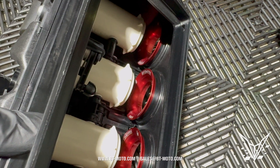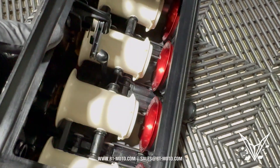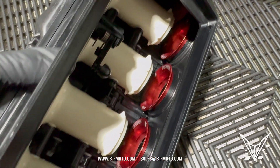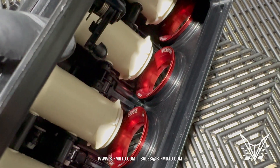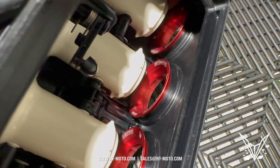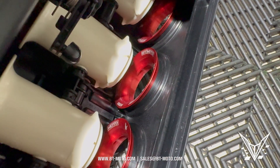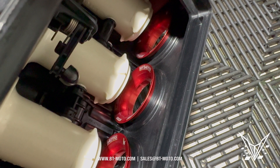Another complaint we get is about oil in the airbox. The oil in the airbox isn't from the stacks — it's from a breather tube in the back that connects to the engine. If you overfill your oil, or if your motor's a little loose, you're going to start sucking oil into the airbox. When that happens, oil gets into the airbox, mists through everything, and actually gets inside the motor, reducing your octane if there's enough oil in there. So you want to make sure there's no oil in your airbox — if there is, you may have a loose motor or you've overfilled your oil.